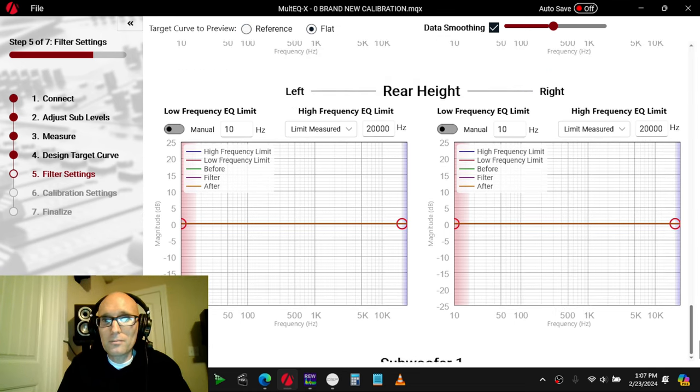So right, we've now got the speakers time aligned to the best of my ability. Again, you can impulse response align. I've done it before, but again, it's not optimal. It's just when a response is heard from the left and the right sub. That doesn't mean you're going to get the best performance, though, right? Things are timing at the same, but again, you've got the phase thing going on as well. You're not going to be aligned everywhere.